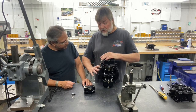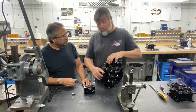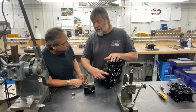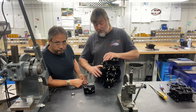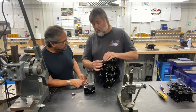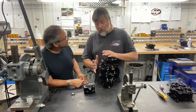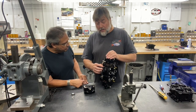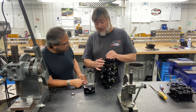Once that's set, it's very critical to make sure that when it is wide open you also have a small amount of movement. You definitely do not want this to bottom out and collapse this spring. Now, not to get too in depth — we're trying to do the basics here — but this spring, as heavy as it is, does play a part in the accelerator.